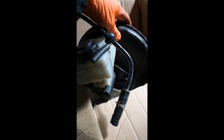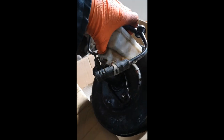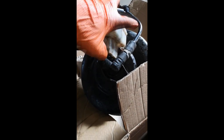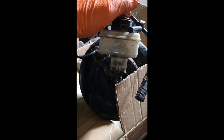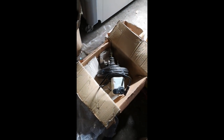Something I thought of — if you did want to put a hydraulic clutch on a ZS or ZR, you could actually use this reservoir for the clutch as well. All you'd need to do is put a small fitting onto here and that would give you your reservoir for the clutch too. That's something I plan to do in the future.